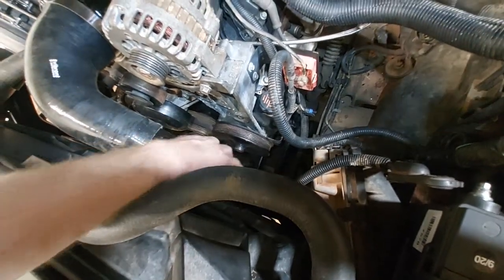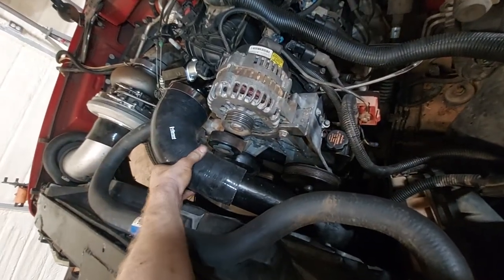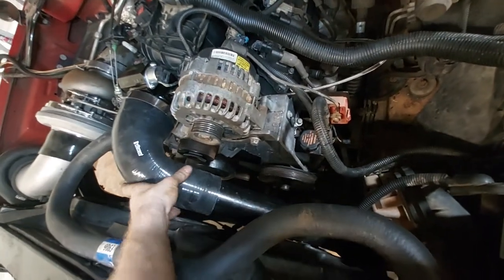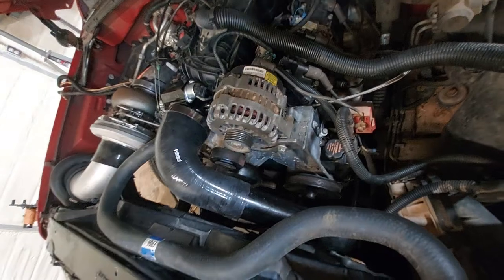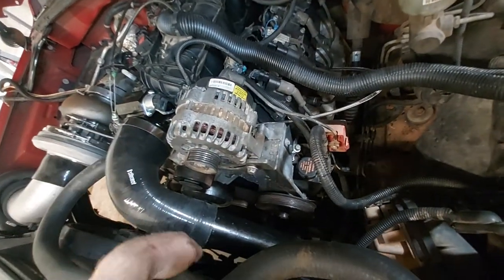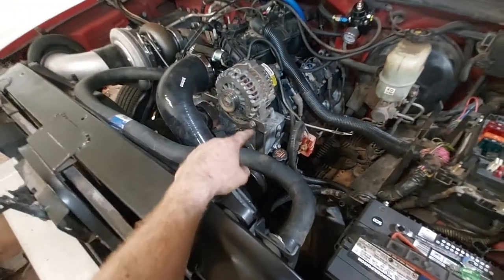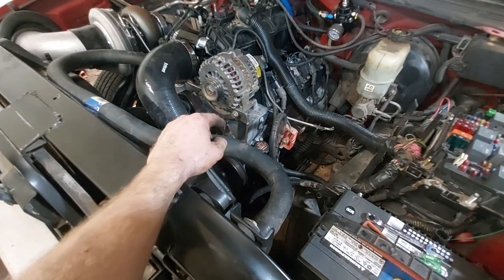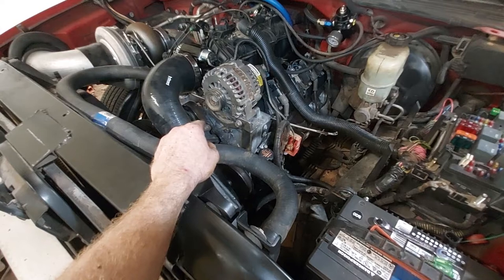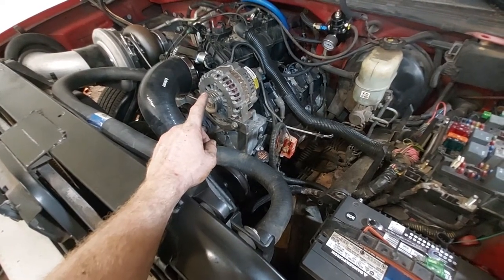This is a Vibrant four-inch to three-and-a-half reducing coupling — had to trim it down a good bit on this side to get it to clear the fan. This is a 6.0-liter out of a 1500 HD. It has 317 heads, a Summit Stage 2 turbo cam, their springs, Trailblazer SS intake, and a 102-millimeter throttle body.